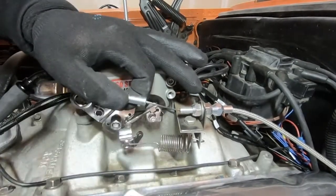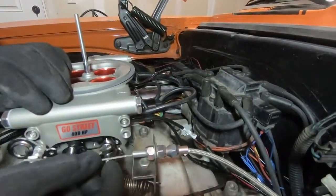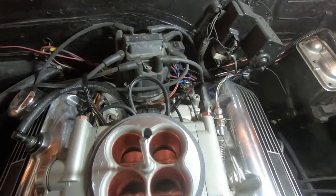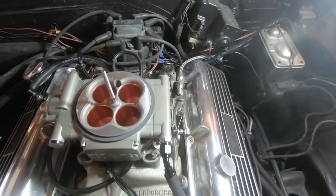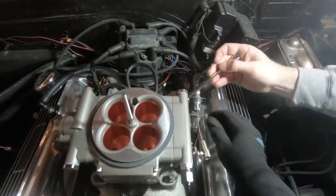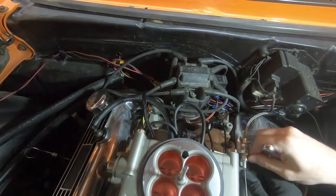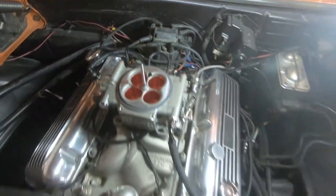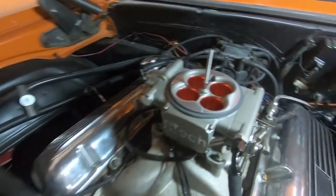Well, that took all the play out. We might be moving this plate back just a hair, but the nice thing is we've got it really close. We can move it back just a little bit right there - you're at full throttle. We'll move the plate back so there's no play at all. Now you're starting to pull the throttle back in just a hair - that's probably good right there. Go and see what you think - you felt it before. Now we've got such smooth throttle, it's gonna be a treat to drive.